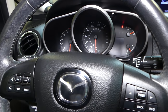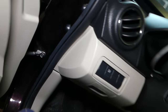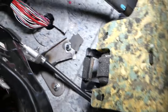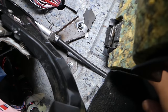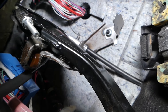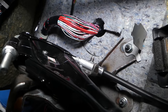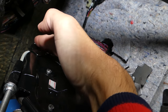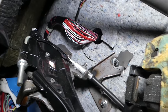Let me turn the car off and explain what causes that. The same reason applies for cars with the hand-pull brake, not just the pedal type. On every handbrake, you have a cable that pulls the brakes — this is a heavy-duty cable. When you press the pedal, you'll hear a click. That click is a little switch that activates when the brake pedal is pressed. That switch sometimes goes bad. Usually it's located right there on top — that's what's causing the light to stay on.